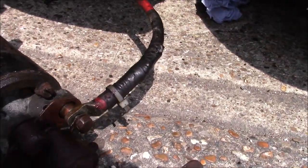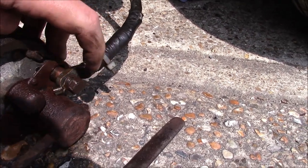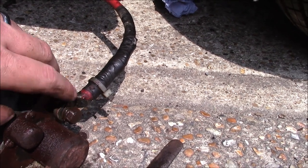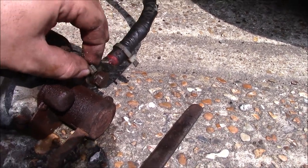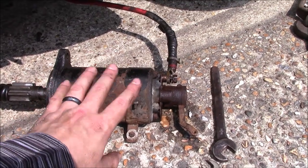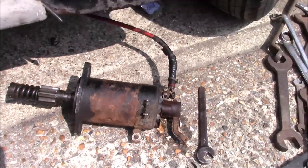The bolt you access from in front of the car is this one. Now that we've got it out from underneath the car, Pat managed to undo that, which is a quarter inch. The problem we were having trying to do it on the car is this wire - I'm not sure what that's for yet, we'll find out - but this wire had actually snapped as we took it out. It looks like the crimp's just given up and the wire's just gone brittle. Not a problem. But that was basically acting like a locking washer and it wasn't letting us get any tools on there. So we had to get this out before we could disconnect it. So now we can find out what's wrong in here. It probably just needs a clean, to be honest, and get this working properly, and then we can start the car a lot easier. Reassembly's going to be a bit easier.